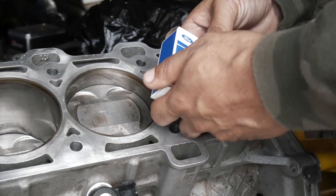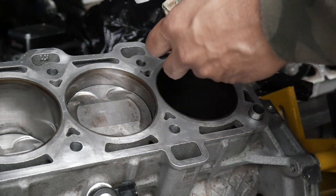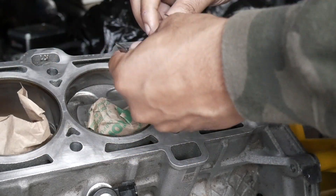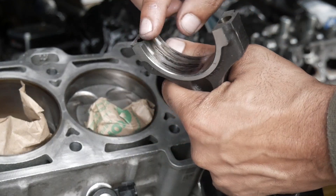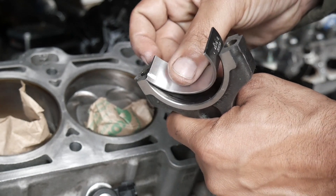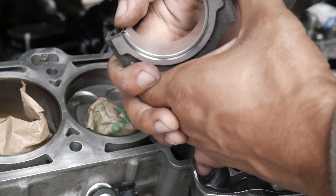All right, we're good. This thing's ready to go in. I'm going to be putting on my new rod bearings, so we're going to pop these out — these are the ones that I got from Ford. You open it up and we can see inside all this nice brown paper is our new bearing. When you're looking at your piston you're going to see you have these little grooves right here off to one side. You have the same thing here with your rod bearing — one section of it is going to be grooved. So what we're going to do is line one of those grooves up with that groove and push her down into place, trying to make sure it's as level with the top as possible.